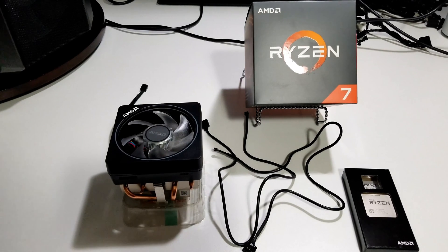One school of thought says: if you plug in just the USB plug into your motherboard, that allows the software that came with your motherboard to control your Wraith Prism for all the colors — inside, outside, all the LEDs. The other thing is if you plug in both of them including the RGB, what happens is you can't control both — one could be controlled but not the other through the software. We're going to start with just the USB.